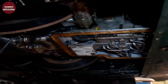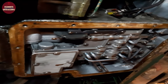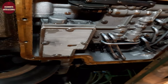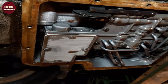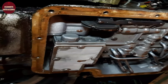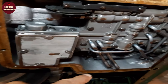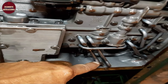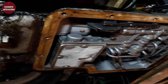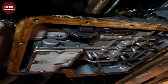Before I seriously start driving with the car, I first changed the oil in the Borg-Warner gearbox and also replaced the filter. The sump cover was removed and you can see the oil filter here. That filter also needs to be periodically cleaned. A nice detail is that there's a small magnet inside — that magnet is to capture fine iron filings, and indeed there were some fine iron filings on it, which I cleaned off neatly.